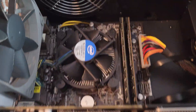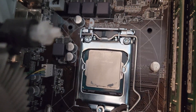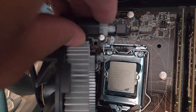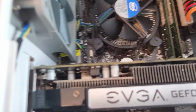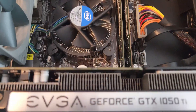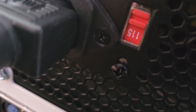Now that we've checked the power supply and got everything cleaned up front and back, let's check the CPU. Open up the CPU cooler, pull it off — you want to make sure the CPU is actually there and then go ahead and repaste it, because a lot of people who sell these don't take good care of them. Quick repasting job done, cooler firmly back on. Make sure the GPU is seated right — it looks well seated. Check the RAM and motherboard — everything looks good. One really important thing: make sure the voltage switch on the back is set to 115, not 240, or you'll blow it.